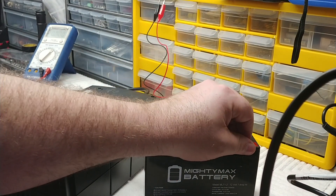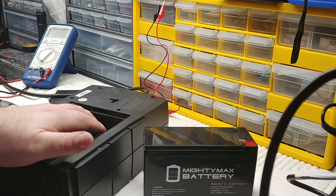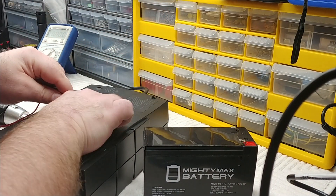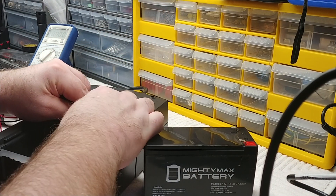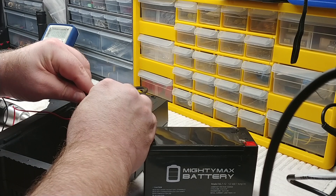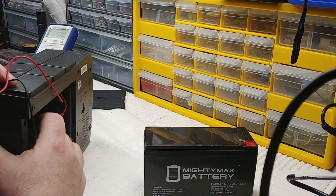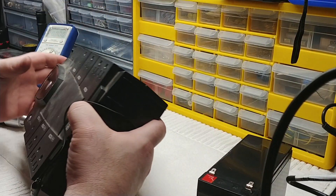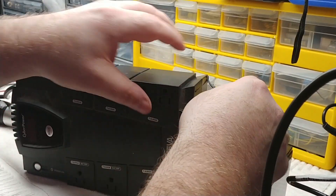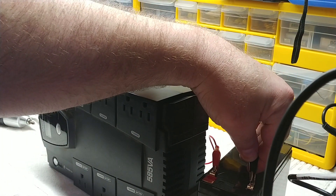For a quick test you can do at home or in your shop: take the battery out of the unit and use a couple of alligator clips. Hook them up to the unit's battery leads first — red positive to positive, black negative to negative. What we're doing is simulating as if we had a battery already inside the unit. This way you can test whether it's going to fix the problem before wrestling the heavy battery into place. Clip the leads on.